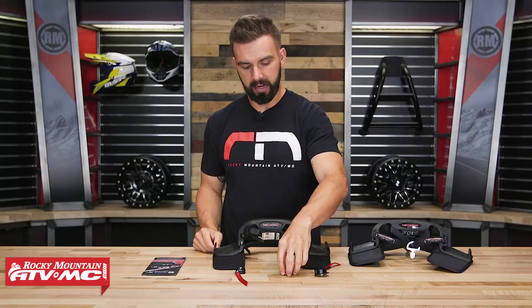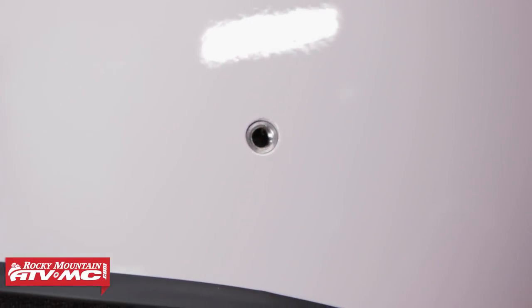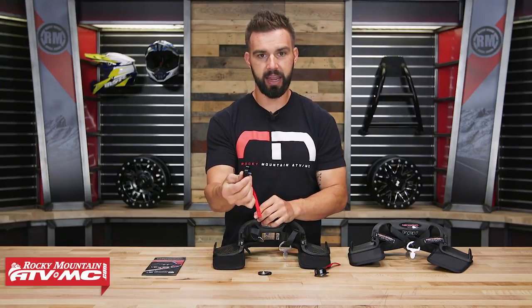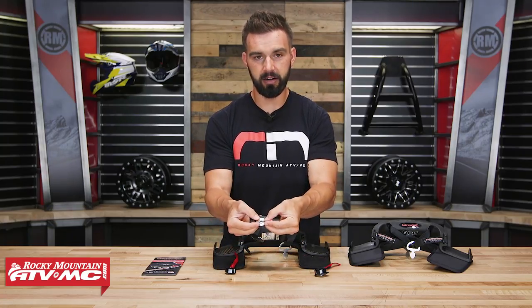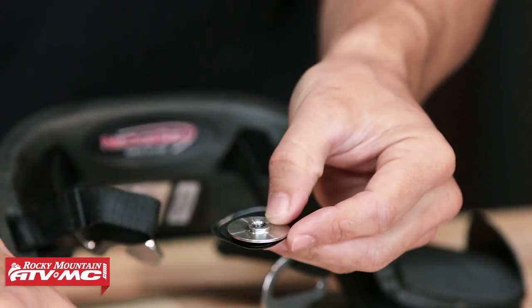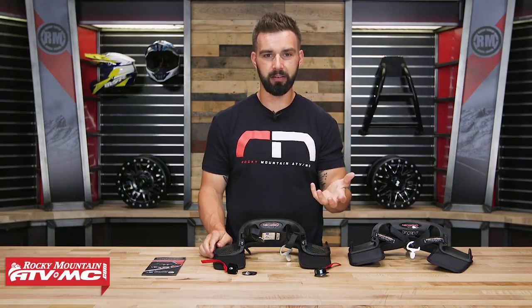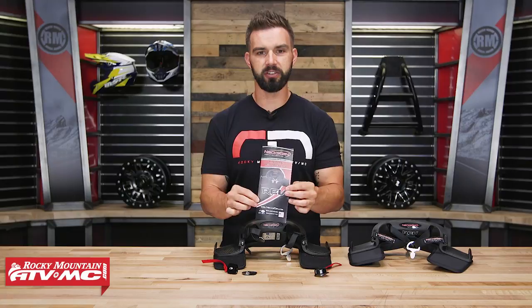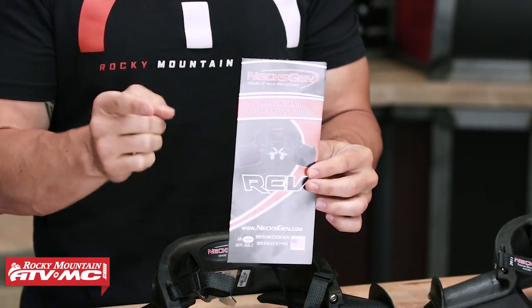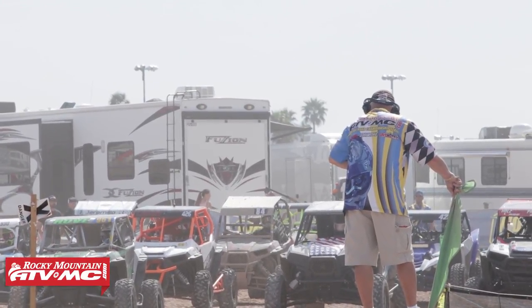For installation on your helmet, there are three options to keep in mind. Some helmets come with holes pre-drilled that have inserts bonded in — in that case, just screw this piece right into that bonded insert. Some helmets have holes pre-drilled but no inserts bonded in — in that situation, take the flat piece, mount it on the inside of the helmet as your insert, then screw on the outer piece. Some helmets won't have any holes drilled at all — you'll need to drill them. Make sure your helmet is SFI approved and meets mandatory safety requirements. If you need to drill, pick up the manual from NextGen — it gives detailed instructions on where and how to measure and drill for the hardware kit. Follow the instructions carefully, and once done, you're ready to wear your head and neck restraint device.